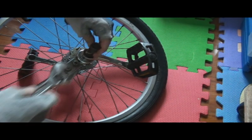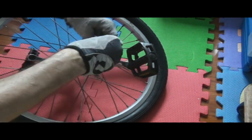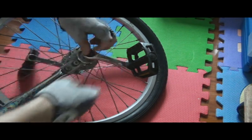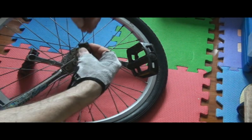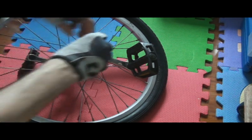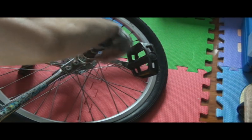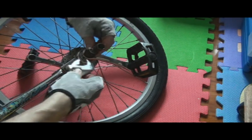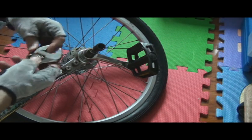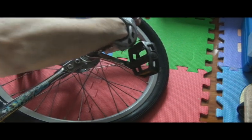Take off the nuts, take off the crank using a crank extractor. You've already tried just tightening it up and that's never worked — it comes loose again in a few minutes.